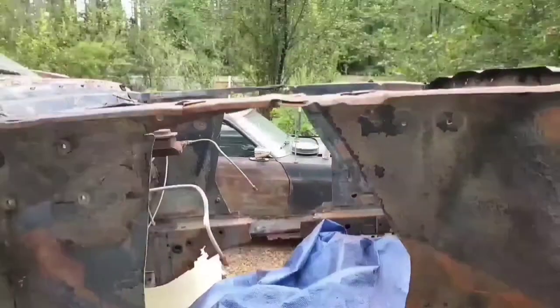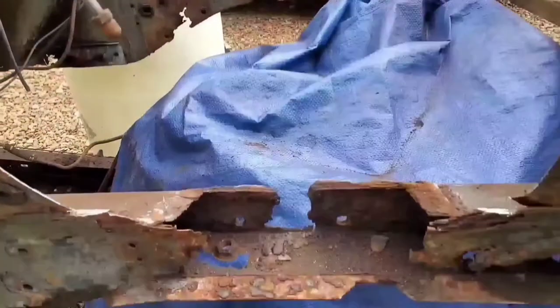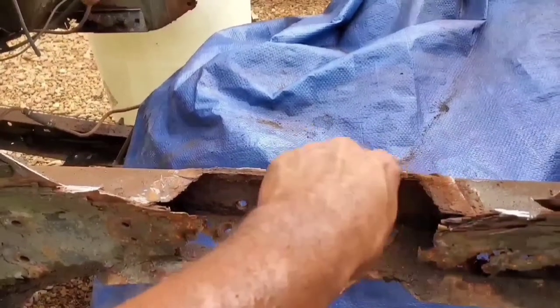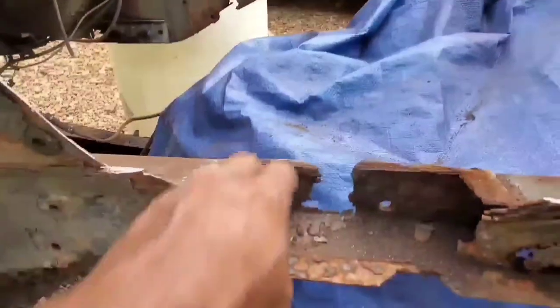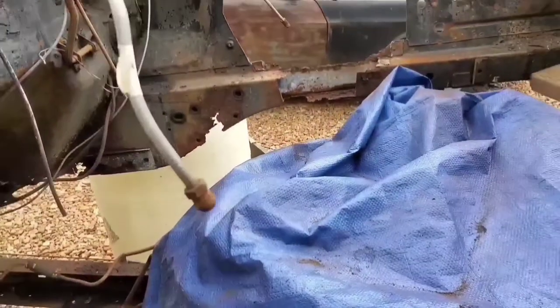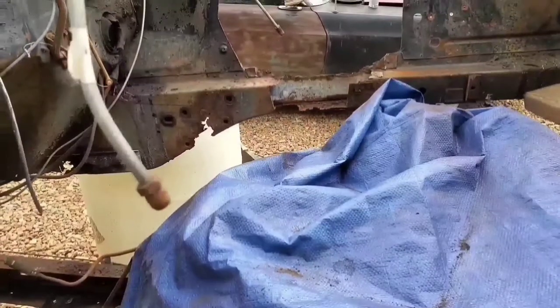Got our right shock tower hacked out. Also took the time to whittle away at this extra metal from where the shock tower body was welded to the subframe. Same thing on that side, in order to help smooth all this out as much as possible. So when I do put some angle iron and flat stock on here, it won't be sticking out as badly.